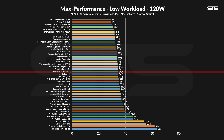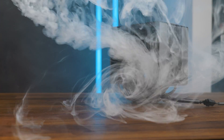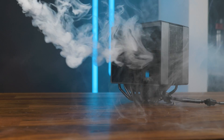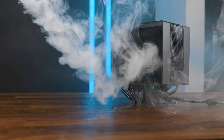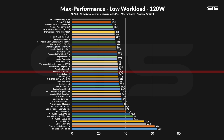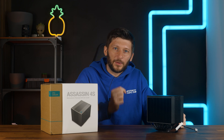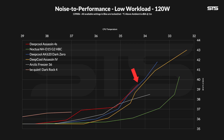There are actually two ways of looking at this. If you try to filter it among dual-tower coolers with a high heat pipe count, this is one of the worst coolers we have ever had on the table. But that one single 1800 RPM fan not only has to pull through one heatsink, it also has to push through another one — that's quite the workload for a single fan. The thing is, noise: it's not loud at max anyway — between 39 and 40 dB max. From there going down, it almost aligns with the AK-620, after which it then drops down quite a lot, but never to the point of something like the Dark Rock 4.